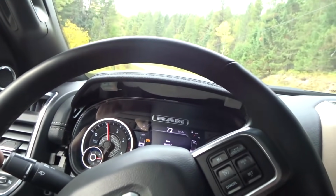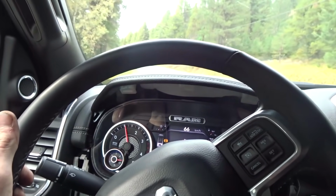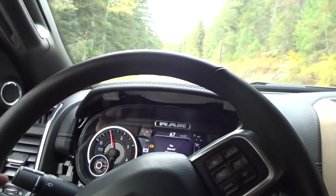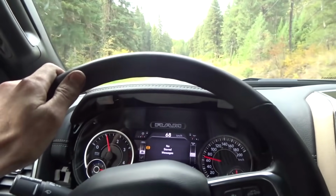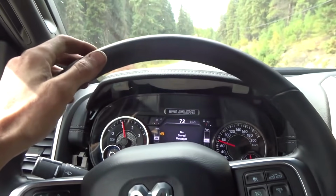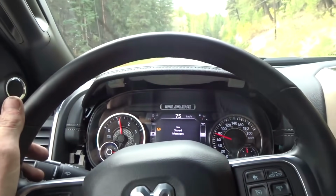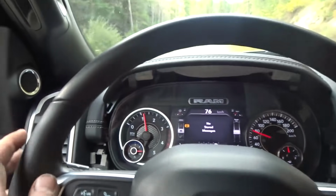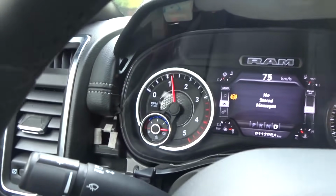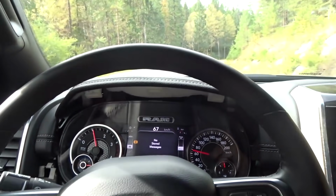And I was pretty much able to make most of the features from the 4th gens work on this truck too. This thing has a 68RFE, so I'm fully able to tune the 68RFE in this thing. So I turned up the pressures a little bit and adjusted the shift points a little bit too. And I make it so the exhaust brake stays on when you turn off the key, and the DEF never runs out, it's always full. So yeah, pretty much done with this video.